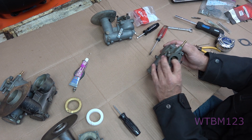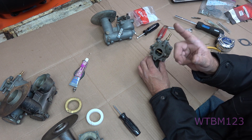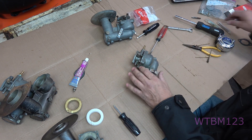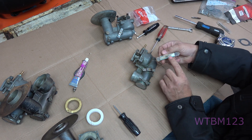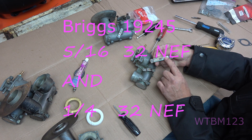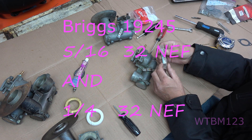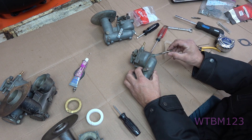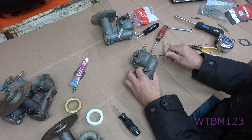Make sure to watch when you first start screwing it up in there that it goes up in there — I have seen them come up the side and bend because of not paying attention inside. Now if you mess up these threads, you can get a tap. This one here is 5/16 by 32 — this is not a regular size tap. You can look at the Briggs tools and get the right size, but these are 5/16 by 32 pitch and you can re-thread or clean up the threads in here.